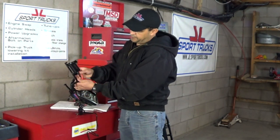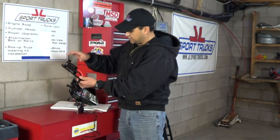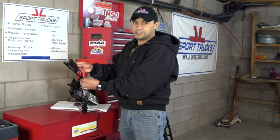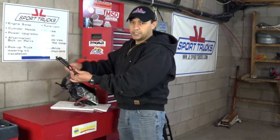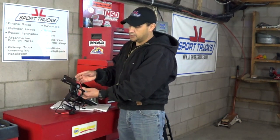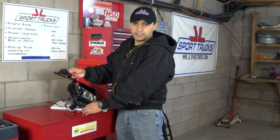Another thing that I made — I welded a tab to bolt the ballast right above the headlight, so everything is going to be easy to get through and easy to install and remove if needed. So if any of these components ever fail, it's going to be easy to replace them without tearing the whole vehicle apart.